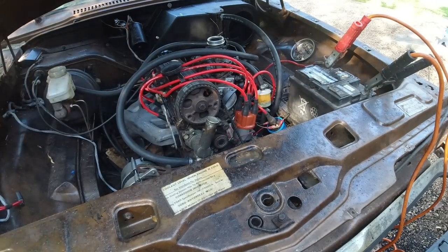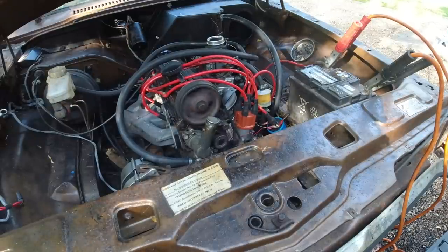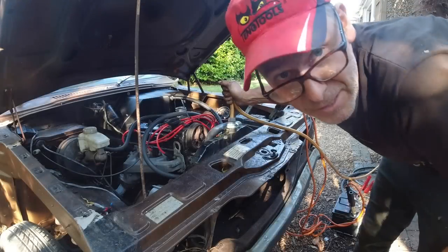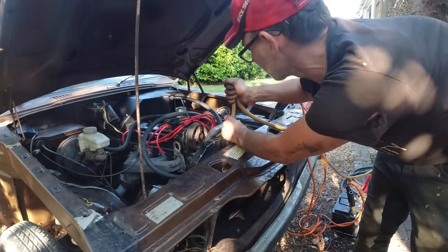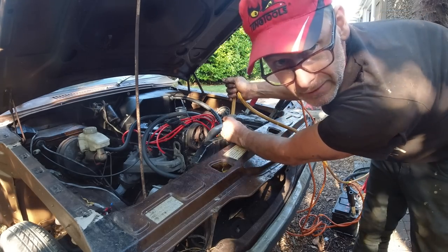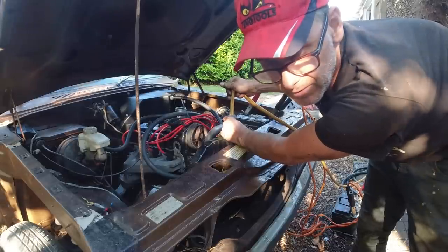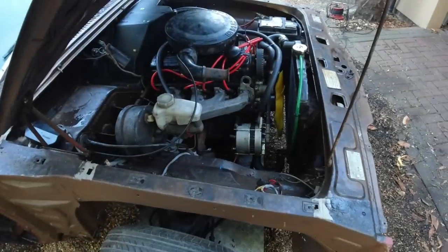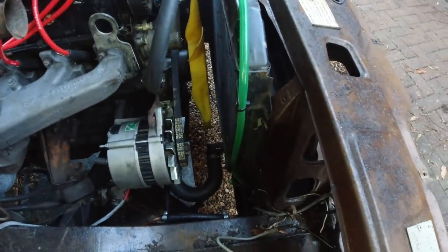I can get the radiator in now. It's got a tappy cam, all right. Okay, radiator is on, because we don't want to run this for too long without water in it. But not only can I not find my water can, the viscous fan hit the radiator. I didn't realise you can actually fit the original type early fans to the viscous, and the bushing just pushes through the centre of the fan. Right, I've got the radiator in. I've put the original Cortina fan on it because the viscous one hit the rad.